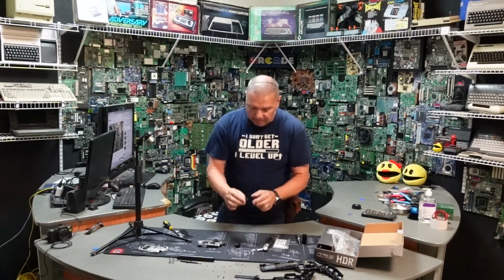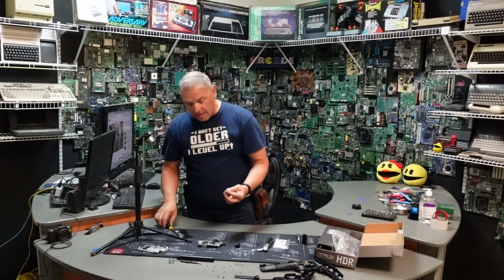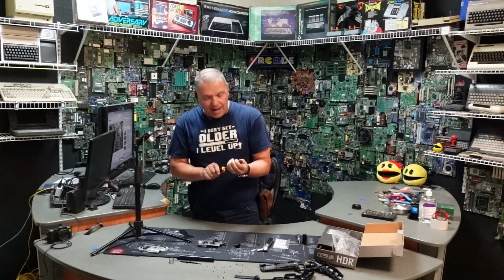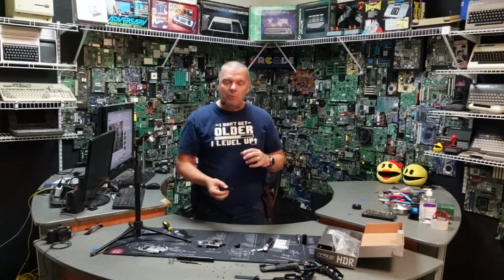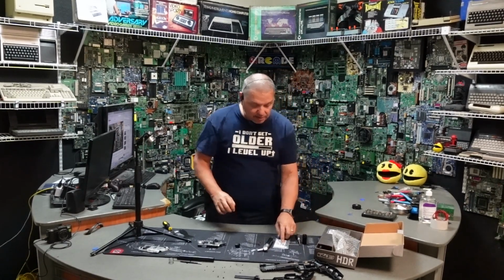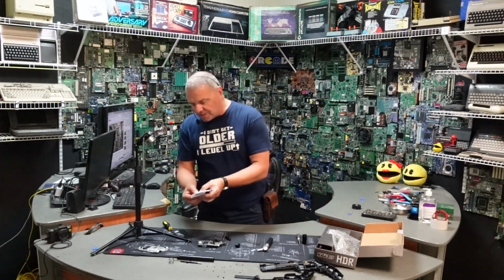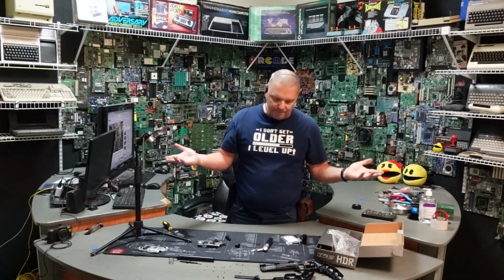All right. Now, one of the valves we need to change is right in there, and it's a very short little valve, very small, but they have a tendency to use a Loctite on this that will not allow you to access it. If that's the case, all you need to do is heat this up, and normally a lot of people will use a heat gun on like a low setting to break that, to get that out of there. And then once you've heated it up, you can pull that valve out and stick the new valve in. I'm not going to make you watch that, but that's all you really want to do. And the only difference is that valve is a tiny bit shorter and allows for a little bit more pressure release. So, yeah, there you go.